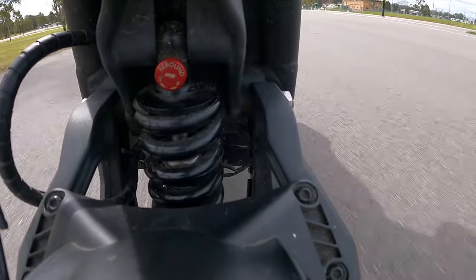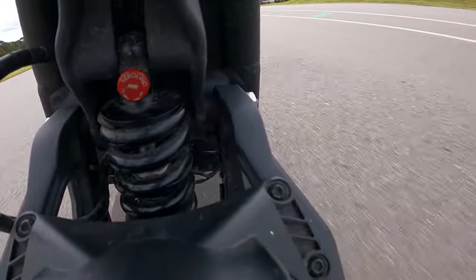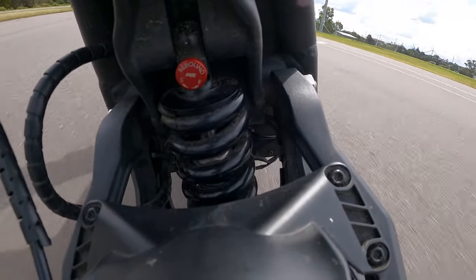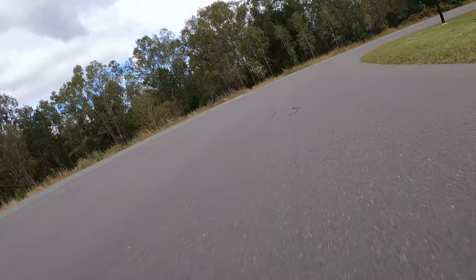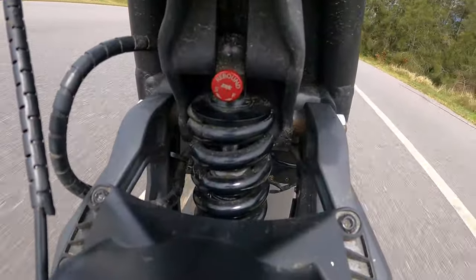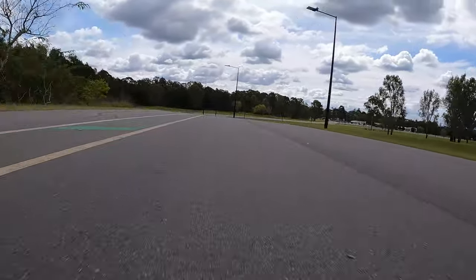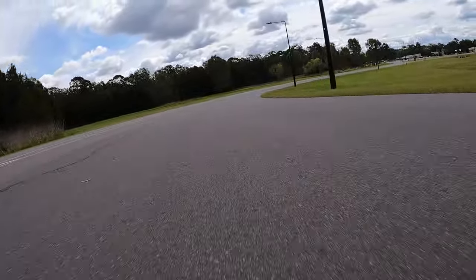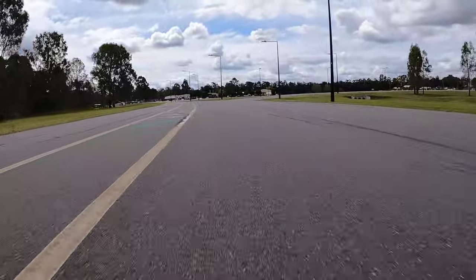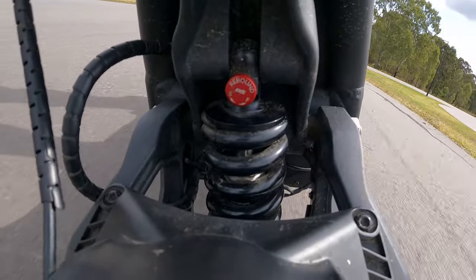You can really see what the suspension is doing here. I'm going to try and do a hot lap - let's try and hit this corner at some speed, 60-62 kilometers an hour. Leaning in - mad vibrations, that's going to have to be sorted out. Slowly pin it out of the corner, get past that vibration. Hit an 80 there. Going into a hairpin at speed - got the speed wobbles again from those unbalanced tires, it's really shaking me up.